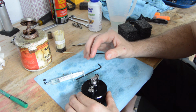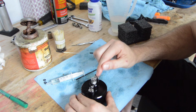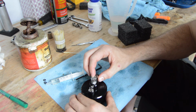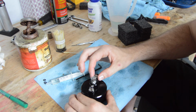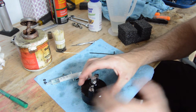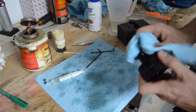There it is. Okay. So from this point, I should be within 1/4 to 1 full turn from bottoming the screw out. And I am, just shy of. So with this being the bottom of the screw, I know that the fluid level within the damper is correct. Okay guys, I have rebuilt my damper, and as you saw a minute ago, it passes the test.